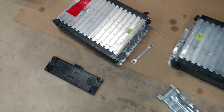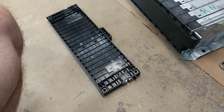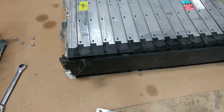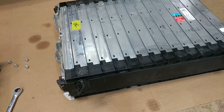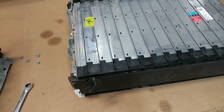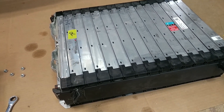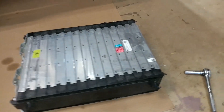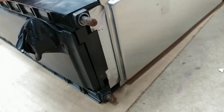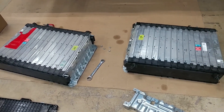If you just take the nuts off the all-thread, you can slide these caps off and swap them out. The batteries do get pretty floppy if you have those threaded rods not tightened down, so you can make sure they're set flat on a reasonably flat surface. And there's the pouch right there — you need to be careful that you don't jab any tools in there or anything that could break it. That'll let me get the number of cells in the configurations that I need.